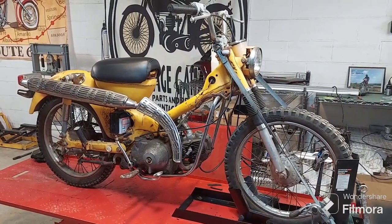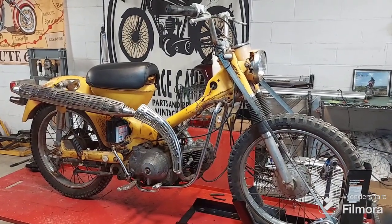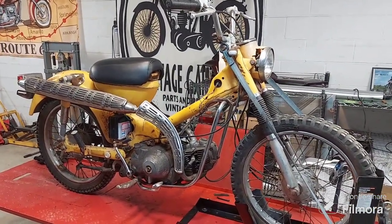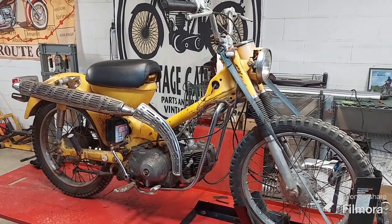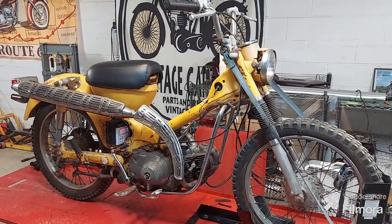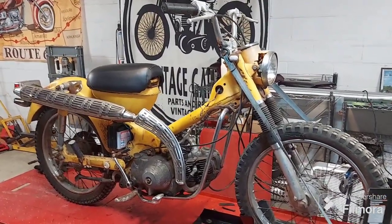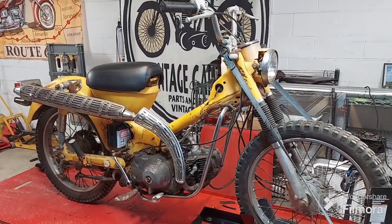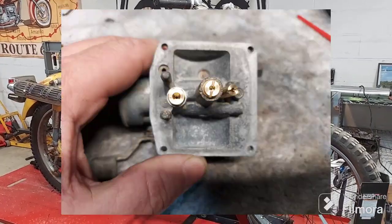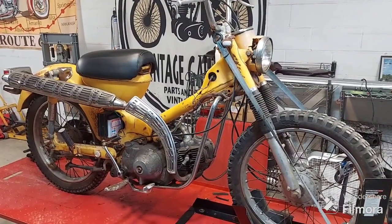Welcome back to Dragon Works. We're back on the 1969 Honda CT90, also known as the Trail 90. In the last episode — Part 1 — we did some basic diagnostics: a compression test that came out good for a cold engine that's been sitting for 17 years. We didn't have spark yet, got permission from the customer to go deeper, got spark figured out, got the carb kit and cleaned that up. Let's see if we can get this thing started for the first time in 17 years.